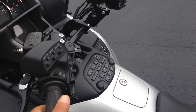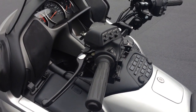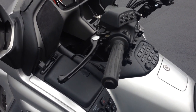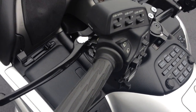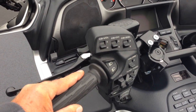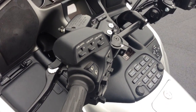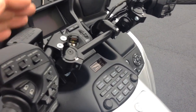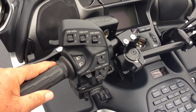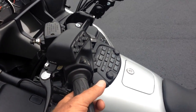This is particularly exciting for people that want more of a sporty riding position. There are a lot of us that do — to really get a much better sport position, better feedback from the front end, a lot more leverage. In addition to the forward and back, this is key to the patent and what makes this handlebar design so unique: depending on where you adjust this for reach, this angle has to be compensated on the horizontal as well, and I'll show you the difference that makes.